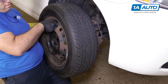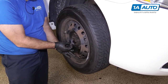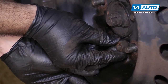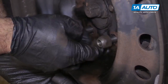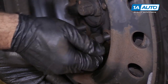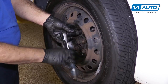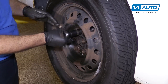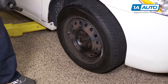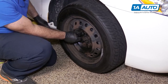Reinstall our wheel. Important to note: these lug nuts have a taper — the taper meets the wheel and matches the inside of the wheel. Don't install them on the flat side; that is incorrect. Install them with the taper to the wheel — it helps locate the wheel on the lug nut stud. I'm using the socket and ratchet to bring these down snug before I put the car on the ground, then torque the lug nuts to 76 foot pounds, going in a cross pattern.